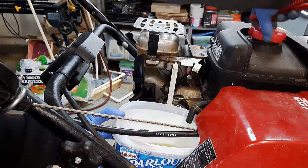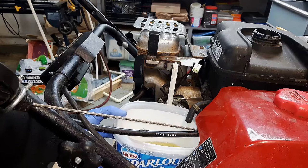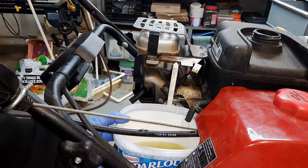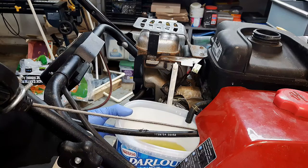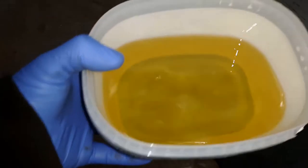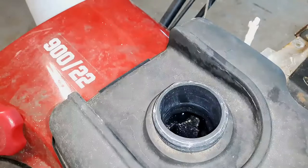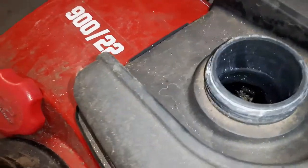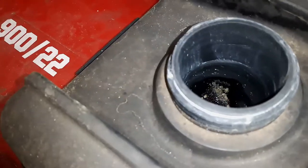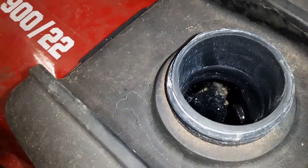Sometimes opening the fuel cap will help drain the fuel a little faster. The fuel does look a little worse than I expected — it's a little bit more yellow and tinted. It should be a nice clear with a very tiny bit of yellow. I would think that this is last year's fuel or maybe fuel from the spring or summer. I'm going to drain all this fuel out and put some fresh fuel in. You can see there's a whole bunch of sediment and junk right down there in the lowest part of the tank where the fuel line connects.